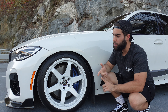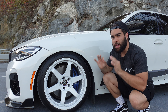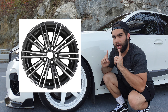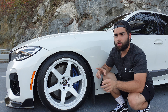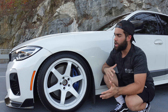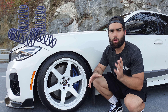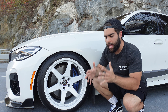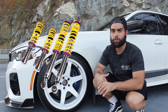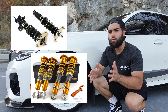You can get whatever wheels you want — Apex, TE37s, Vossen, Vorsteiner — there are so many options. I definitely think you should upgrade the wheels because not every M340i comes with good ones. A lot come with run-flat tires on seven-inch-wide wheels, so aftermarket wheels and tires are a super great mod. Now for lowering springs versus coilovers: if you want your car to handle really well and have extra money, go with something like KW V3 coilovers, BC Racing, Öhlins, or whatever your preferred setup is. It will make it handle way better than lowering springs or stock suspension.